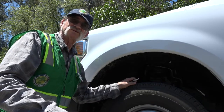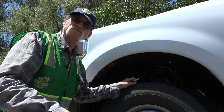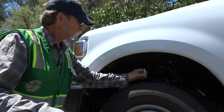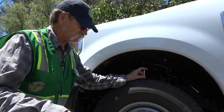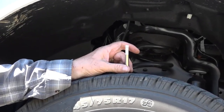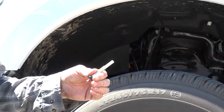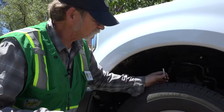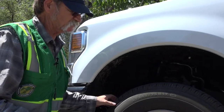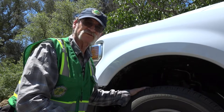It's very important to have good condition tires when you go out behind the evacuation lines — the last thing we need is problems with flat tires, and we don't want to become a burden to the authorities behind the evacuation line. The minimum required by law is 4/32nds of an inch on the front and 2/32nds of an inch on the back. That is street legal, but going out behind evacuation lines we would request that you have better tires than just the minimum. The tread depth on these tires is 13/32nds. There are wear bars on the tire that when it gets down to 2/32nds of an inch, the wear bar will be exposed, so you know the tires are becoming illegal.